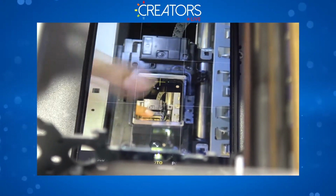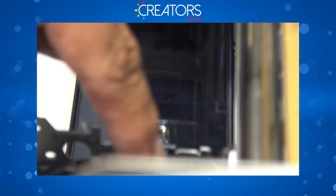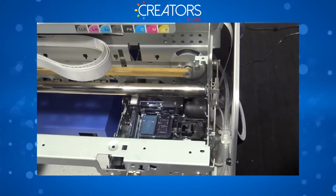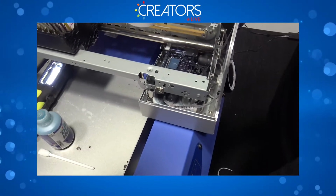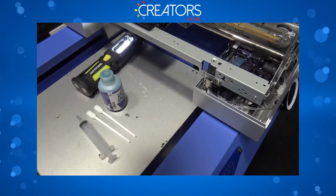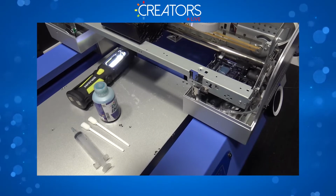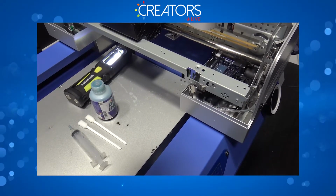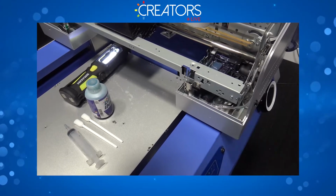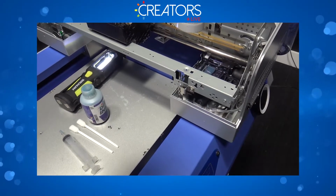This is how you want to leave this area at the end of your day. Now we're going to move on to the wipe blade and capping station. For that, what you're going to need is super nozzle cleaner, two swabs, a syringe, and your distilled water. Now remember, you're working with water in a cup. Do not place it on top of your printer, because accidents do happen. You don't want to spill anything on top of your printer. So let's set this water over here.